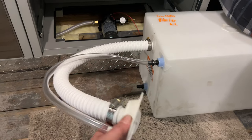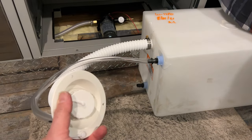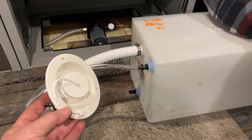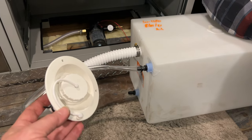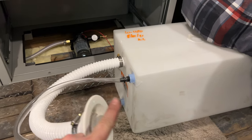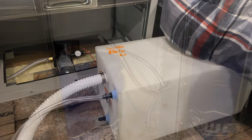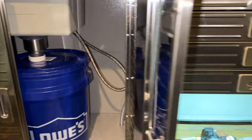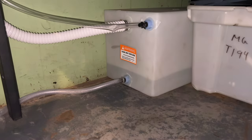Here's what that will look like — I have the vent hooked up, I have the fill tube hooked up, and then you mount this on the outside of the truck. I'm going to mount this outside at a later date after I've tested everything and I'm sure I know where I want it to go. For now I'm going to push the tank underneath the bed and hook up the supply to the pump. All of the plumbing is done now. The pump is hooked up, the tank is in place, and I have some water in it to check for leaks.